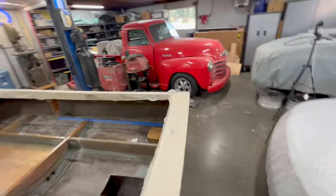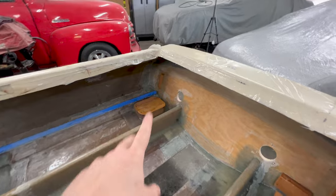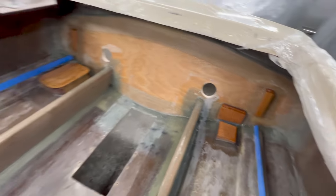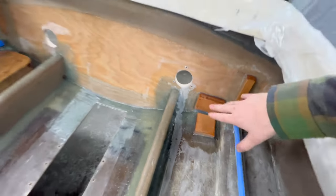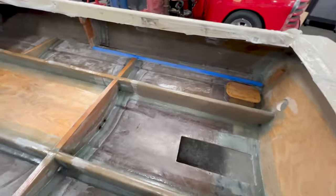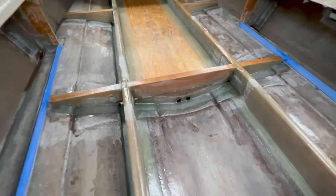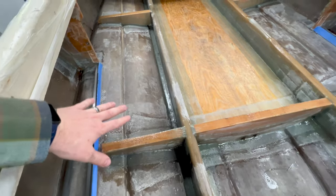Let me show you the final product that we have here. So you can see battery mount, fuel tank mounts, plate diverter, everything's tabbed in, and I've done nothing to address the tabbing to the floor of the boat. I'm gonna come back and address that in the next video. But you can also see that I have the engine box all complete. All my water drains are in, everything's tabbed in. I have it all encapsulated.